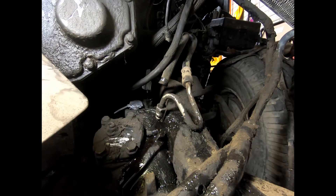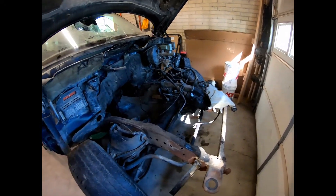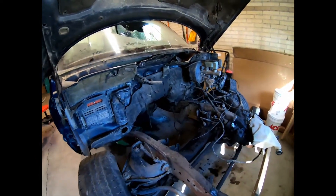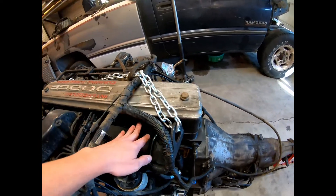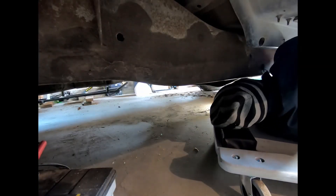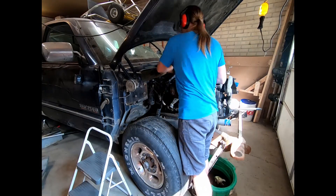Just to cover the parts I didn't quite get on video: the basic methodology I used was I removed the whole front clip and then I removed the fenders. With the whole front clip and fenders off, as well as pulling the driveshaft off, I was able to pull it out the front. There is one issue with this method - that cowl right here interferes with these last two cylinders on the engine. I could have removed the valve covers or the cylinder head, but I just wanted to get it all out in one piece. So I cut the cowl, and we'll see that happening.